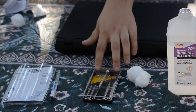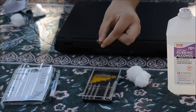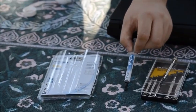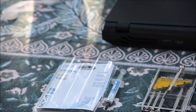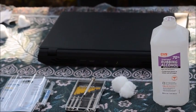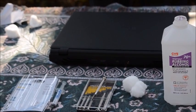I've got a set of jeweler's screwdrivers because I find they work best on the different sized laptop screws on this unit. And for the thermal compound I have some Arctic MX4 ceramic thermal paste. I like to use this in laptops because it doesn't have any metal content, so it will not cause any damage if it lands on the motherboard inside the laptop by accident.